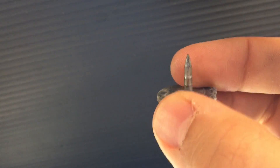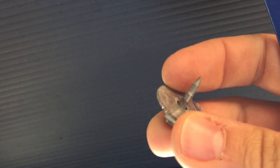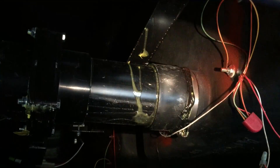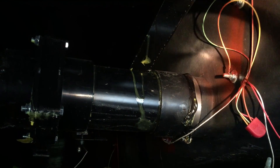These are held together with these nails all along the bottom and up in the front of the RV. So I just kind of gently pry these off, which will lower this down, and we'll see what we're working with. Those are the sensors — that one with the red right there, this one, and that one, and another one up there. So that one is full, two-thirds, one-third, and that guy over there is empty. The two-thirds sensor seems to get stuck on.